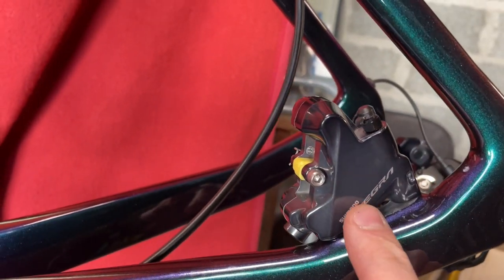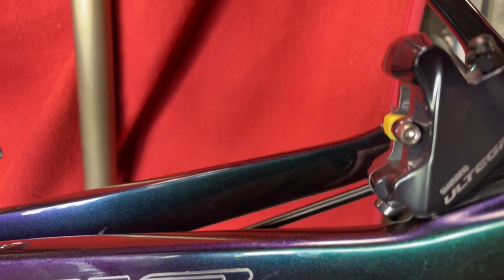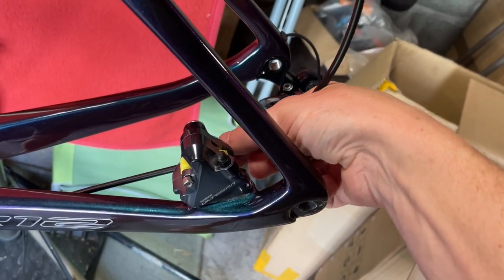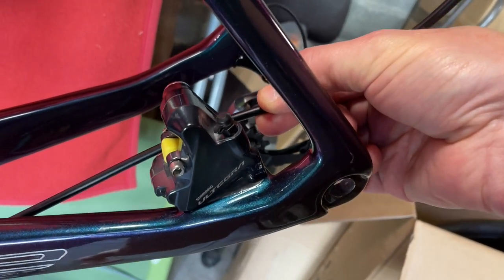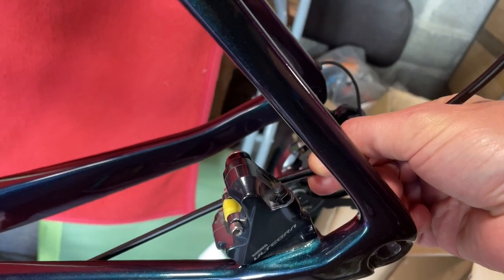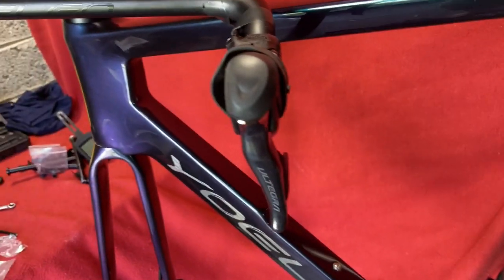Okay we've now got the caliper on the back, and the rear brake is a little bit different because when you turn the bars the cable gets shorter. So at the moment I've got the bars turned right over and it is there. If I turn the bars back it's now there, so I've gained that much. So always cut it off at the shortest point, which is going to be there when I turn the bars back.